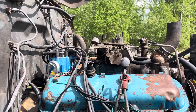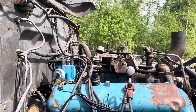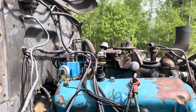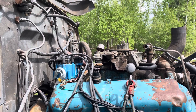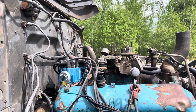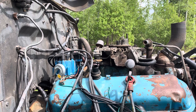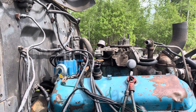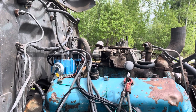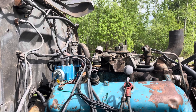Not that that's necessarily the best thing to do, but it'll work just fine. I wouldn't use it this way if the truck was going to be working under full power for sustained periods of time — you have to use a carburetor like that because it's meant to run in an over-rich situation so you don't burn the engine up. The other carburetor will still give it about as much power, but it won't be as rich. So if I was using it under full power — climbing a hill or pulling a heavy load — the engine would heat up internally and cook. But for around the yard, moving a trailer, it's probably better to run quite a bit leaner.